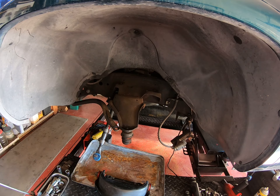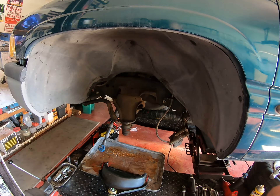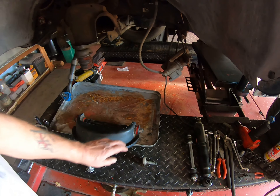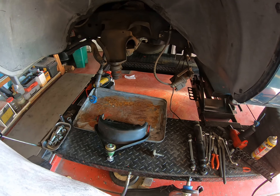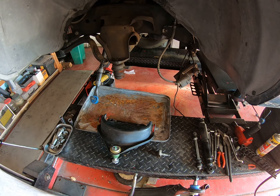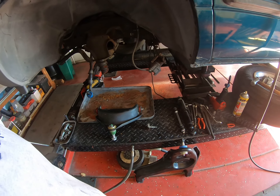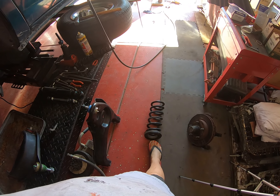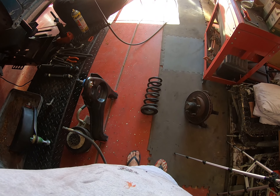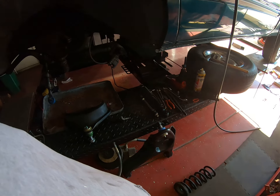I will be putting on the new brakes as well. And if you remember trying to burn out those bushes - yes, you can burn them out - but it's easier to just push them out the way I did, with a length of threaded rod and some spacers. It's less messy and frankly I think that's the better way to do it, but you do what you want. Don't forget the rubber cap that goes in the top.